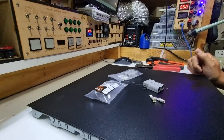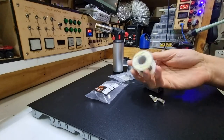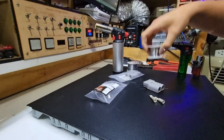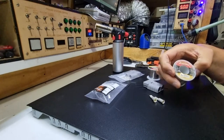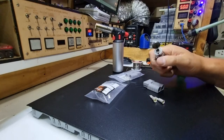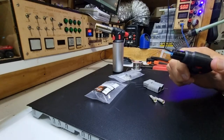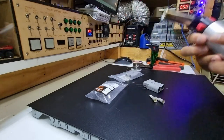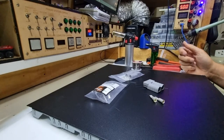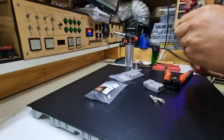I have several sizes of everything. There's 0.71mm flux-core solder which is useless for this; most commonly I use 1mm, though ideally something thicker. For torches, I have a small one that's out of gas, a stoner torch junior that will sort of work, and stoner torch senior which works great but wastes a lot of gas. I prep and secure the cable so it stays where I want it, using these as forceps to hold things in place.